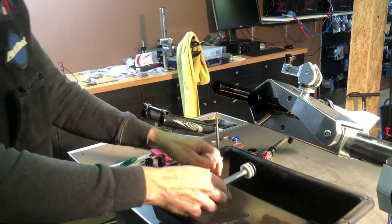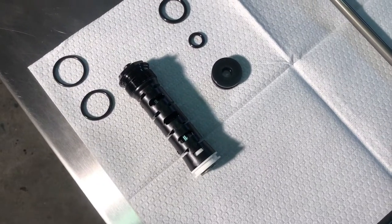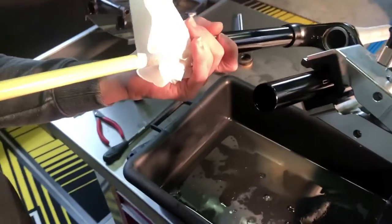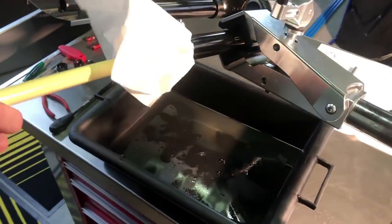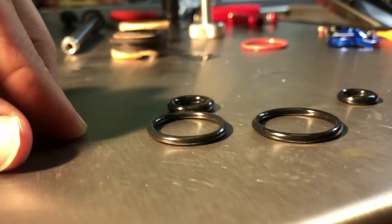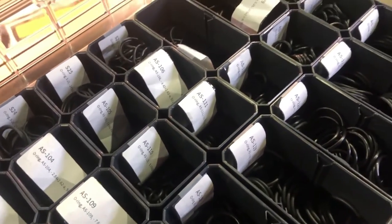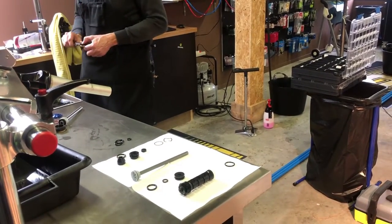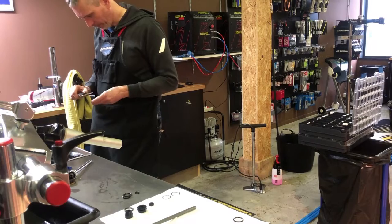With the fork totally disassembled, now comes the fun part of cleaning every individual item using tap water. If you use a sink, make sure smaller parts do not get washed down the drain. Using a shop towel on a long plastic PVC tube, you can easily clean the stanchions without damaging them. The towel is fixed to the tube so you can move it back and forth without it becoming detached. Through time and use, the o-rings become hard and flat, which causes them to lose their sealing ability. Because of that, we replace each individual o-ring. You can buy a service kit for your fork which will include the necessary o-rings. If you don't have such a service kit, you can simply measure the cross-section and length of the o-ring using a caliper.